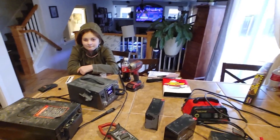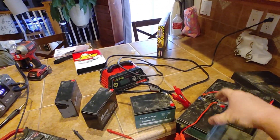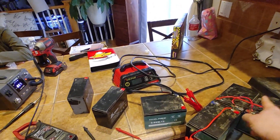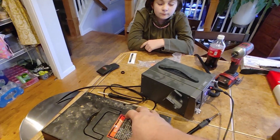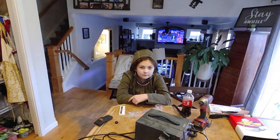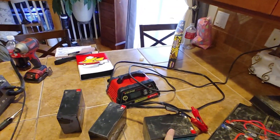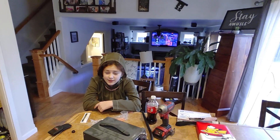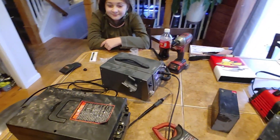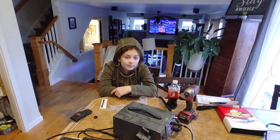So what we're doing is we're taking a complete pack. We took apart the extra pack we had from the other go-kart, stole one of the batteries. We're going to end up adding two of these batteries on top. So instead of it being a 48-volt system — 48 plus 12 plus 12 more equals 72 — we're going to go with a 72-volt system. I've got the solder and iron all fired up. We already desoldered a few of these, so we're going to add two more batteries for a 72-volt system.